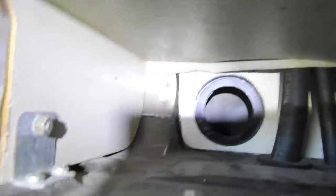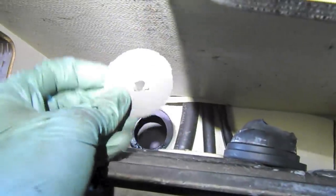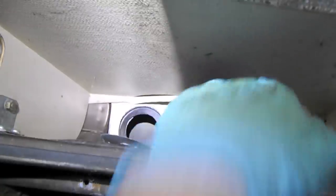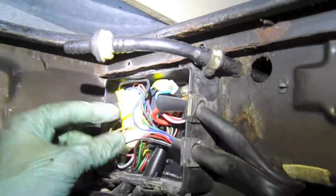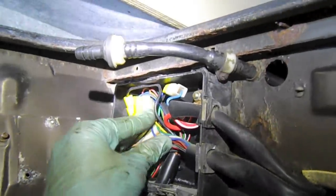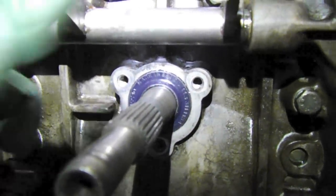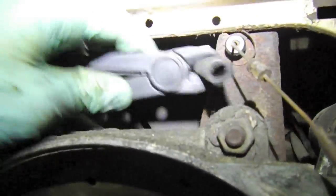The hole is drilled in the side wall here, and it's pretty easy access from the cubby down here. I drilled a bigger hole to clear out the cabinetry and then drilled a smaller hole — this is a two-inch hole saw — to fit the grommet. This grommet squishes a little bit to make it round and it fits perfectly in that hole. I've also started to identify the wires that we need. This is going to be where I put a little fuse for the ignition on. I now have a new input seal on the transmission. Next up I'm going to be reworking the fuel lines — this one's clamped off, this is a supply line.